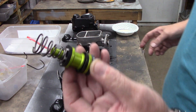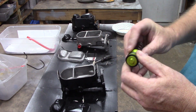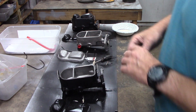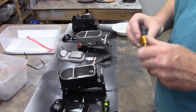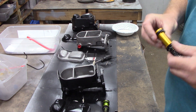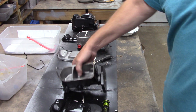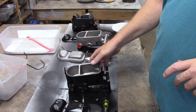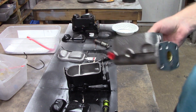See, these master cylinder pistons got cups on them, and you've got to be real careful with them. That's what leaks on your master cylinder — it starts getting pits in that original cast iron bore over time: brake fluid sitting, collecting water, and then that rusts that cast iron. That's one of the reasons even the ones that have never ever been mounted, the NOSs — we go ahead and sleeve those bad boys so that they last nearly indefinite.